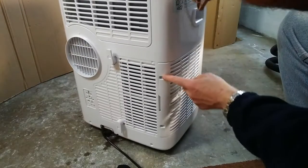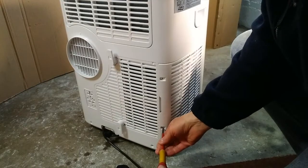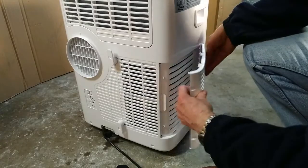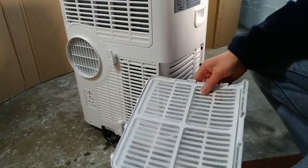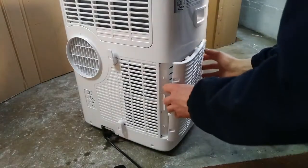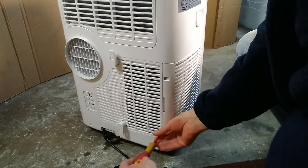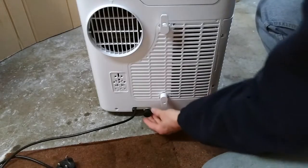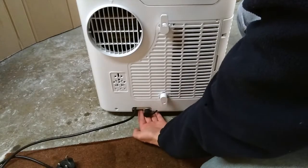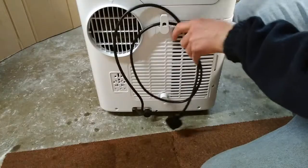There is a filter in the back which you can remove. Down here we have other filters, but this one needs a screwdriver to remove it — at least it's a standard screwdriver and not a tamper-proof type. This is supposed to be removed routinely to clean the filter; again that's fairly flimsy feeling. Same type of filter in there, and one you pull out from here — that really is quite flimsy feeling. Right down the bottom there's a condensate drain, which is annoying because it's so low down. It's okay if you're draining somewhere with the hose, but you won't get much of a vessel under there to catch it. If it was further up it would have been better.